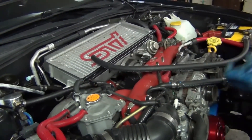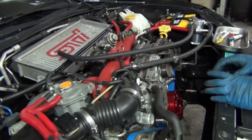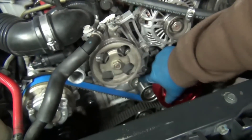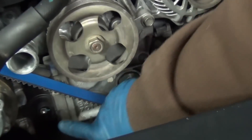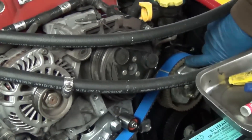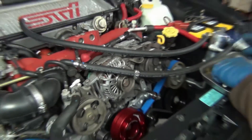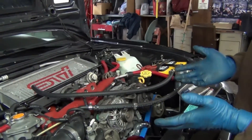I don't feel bad about doing it even with such a pretty motor. If you look down here, you can see it's got white paint pens on here already. This is the plug where you get access to the wrist pin to pull the pistons out if you're going to split the block. There's paint marks on timing marks usually. It's normal to have these little paint marks — I'm going to be considerate and make them color coordinated, and that will help things go really smoothly.